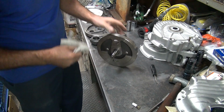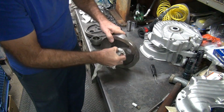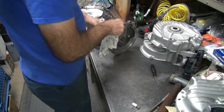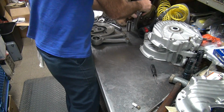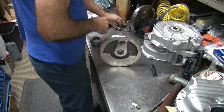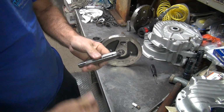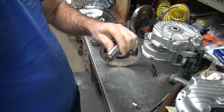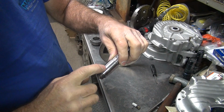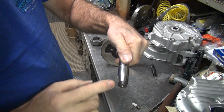Okay. Now make sure you wipe off any excess Loctite inside the bearing area in here. We just want any inside that cage area in there. Looks good. Okay, that's one down. And let this one do the same thing too. Get a clean rag and wipe off your tool parts. That's what shirts are for. Okay, wipe off excess. Do not put Loctite in the oil hole there. It's not a good plan.